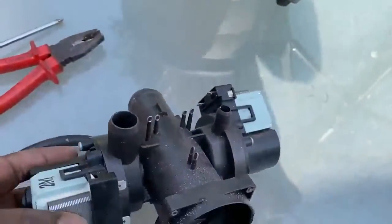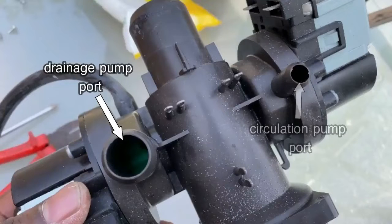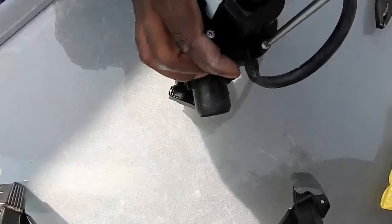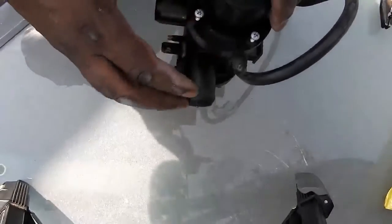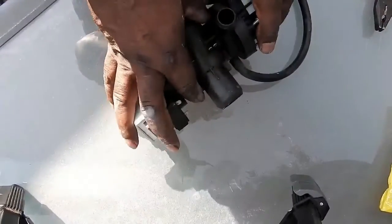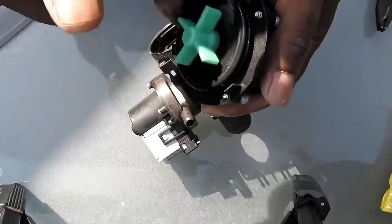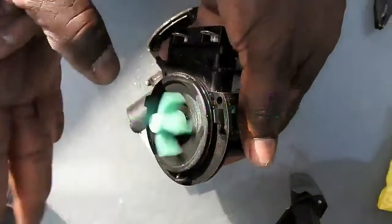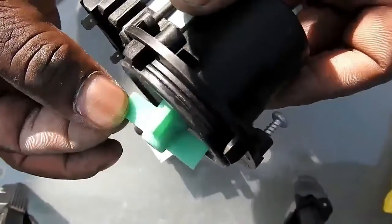It's pretty clear inside. If you have a look, there are two pump outlets — one is the main pump that pumps water out of the machine; the other smaller one circulates water through a little orange device on the top. I'll undo the pump outside — three screws on this one — and straightaway I can see the problem: this impeller is loose, it's doing nothing, just wobbling around. The motor may still be spinning but you can't pump the water out in this condition.